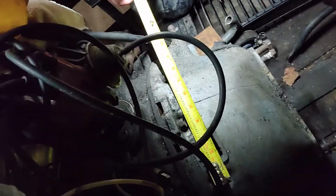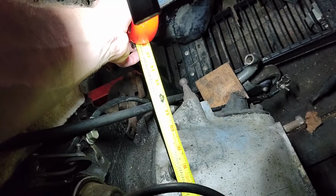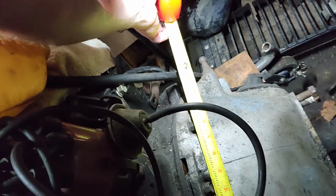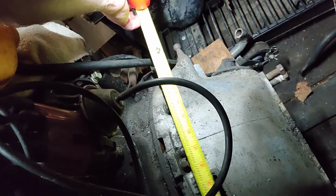Here, if we look right here, you see, wait a minute, you measure from this bolt hole, this bolt, to that bolt over there, you got about 8.25 inches, center to center. So, you see what I'm talking about. That is a manual transmission bell housing. Those were automatics. Notice I said earlier, I said automatic. Okay? Now I measured some other automatics I got behind me here.